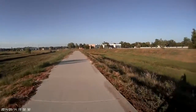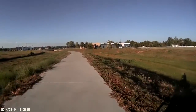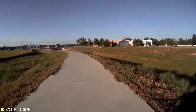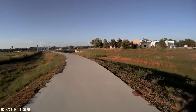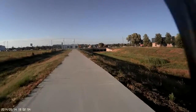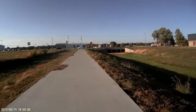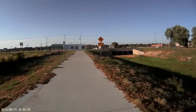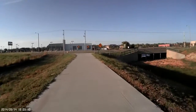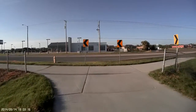I'm going about 11 miles an hour and about halfway there, and already it's a little more laborsome. And you can hear that new hub mechanism kind of making a little noise. I might have welded that up a little off center, so one of those planetary gears may be a kind of a high point as it rotates around in those teeth. But I didn't lubricate that hub, and undoubtedly it'll quiet down on its own. A slight bit of off-center won't be a big deal because it's not a real close tolerance.